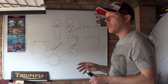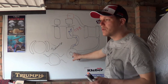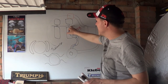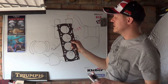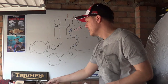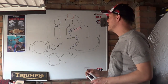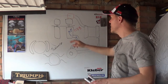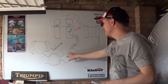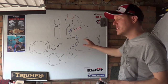One of the ways that it maintains the flow rate, which is also important, is this: as your bike goes faster, your impeller will go faster, and basically you'll flood everything so fast around your system that there'll be an instability. So what you do is you have small restrictive outlets, these little holes that are inside your gasket. On this side, there's only 1, 2, 3, 4, 5, 6, 7. There's only 7 in this head. And this restricts the flow rate of how fast this can go around your system by using the gasket as an actual restrictor. So obviously, as soon as you get up to temperature, your thermostat just stays open, but it's these holes that restrict the rate of flow. And like I say, your impeller is an open cell impeller, so it can always just idle, in a sense. It can carry on spinning and not really impart much force to the rest of the system.